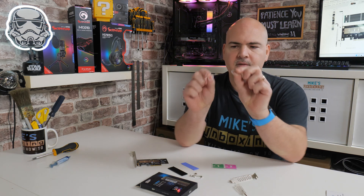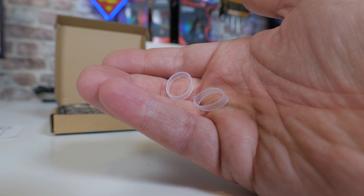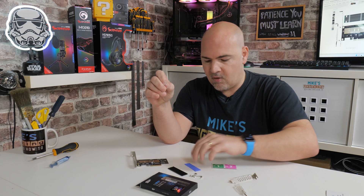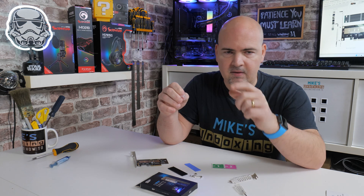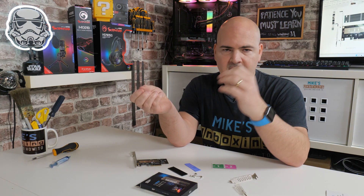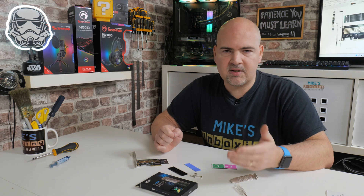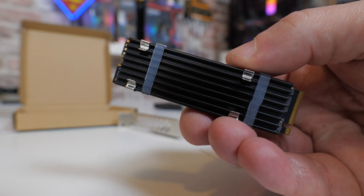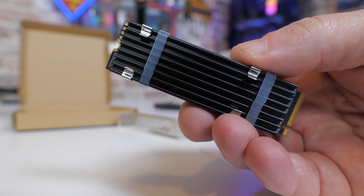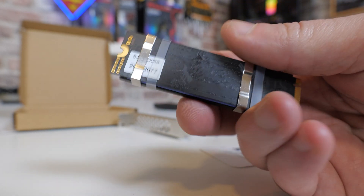One of the best features of this kit — which is so simple but I'm surprised a lot of other manufacturers have overlooked — is that we have three silicon bands. For certain drives, depending on their characteristics, maybe you've got RAM on both sides of the drive and need a thermal pad on both sides. The key advantage is that a lot of other M.2 cards come with screws to attach the heatsink, which limits you by the length of the screws. With this rubber band mechanism, you can accommodate as thick a drive as you want — even if your drive already has a metal plate or an additional thermal pad pre-attached. Links for M.2 thermal pads will be in the description below.